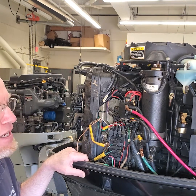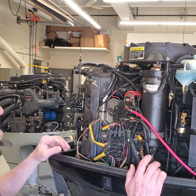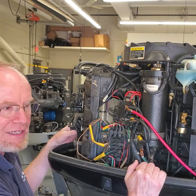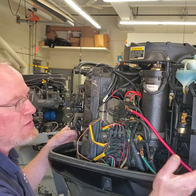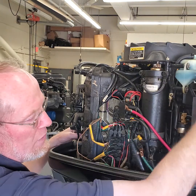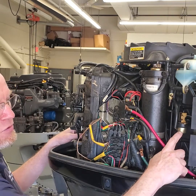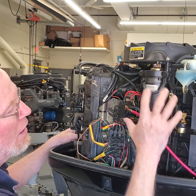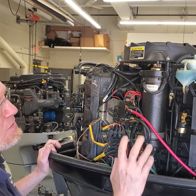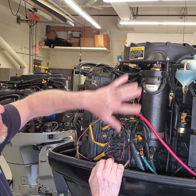Here is a 1998 2.5 Offshore version Mercury outboard, just the cover taken off. A lot of similarities from engines from even the late 70s, early 80s all the way through the 90s prior to fuel injection — you have your three sets of carburetors, dual barrel carburetors, one for each cylinder. You have your enrichener valve here. This has been removed from a boat, it's on a stand here so it's going to look like it's missing some pieces. You'll see this is the oil inlet from your remote oil tank, and then we have our ignition components.